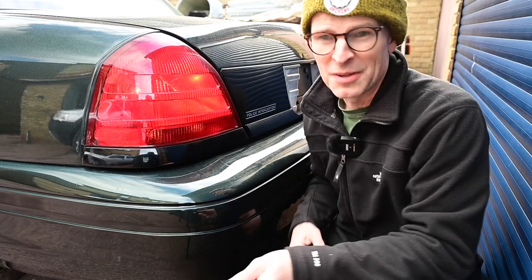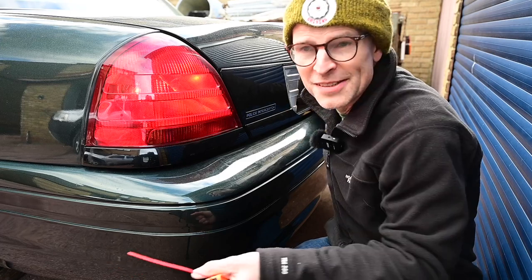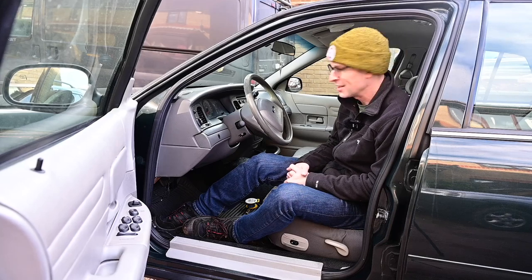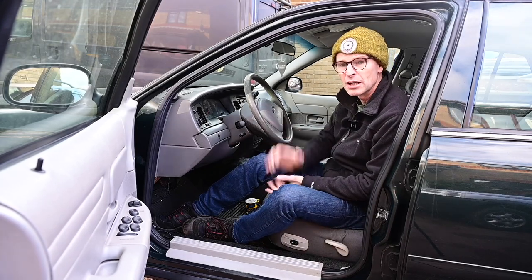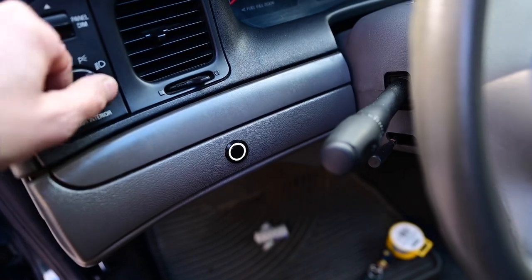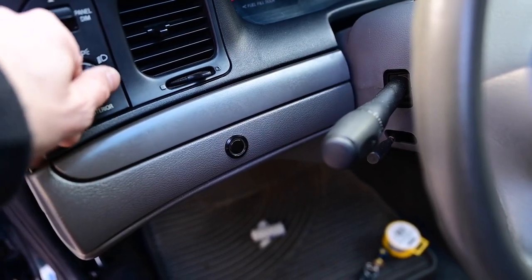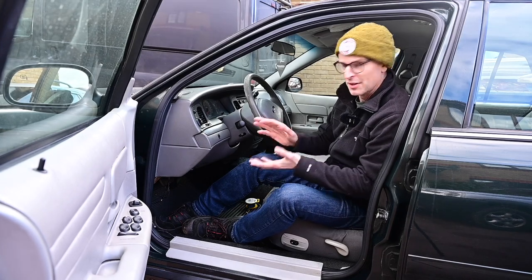Now the last thing that needed to be done here on the back of the car was a fog light. I'd already come up with this idea because I've seen it on other Crown Victorias — to take out the right-hand reversing light bulb and replace it with a red LED of the same kind. The rules have actually changed recently. Previously you just had to have a switch on the dashboard which lit up and you could turn on and off separately. Now they've changed the rules so the fog light has to come on only when you've got the headlights on, and it has to go off with the headlights, and when you turn the headlights on again the light is not on anymore. Which means you have to have a momentary switch and the correct kind of relay.